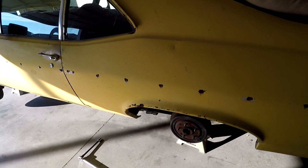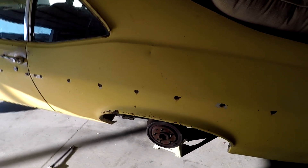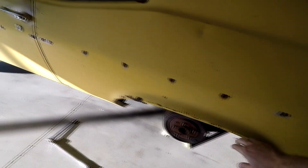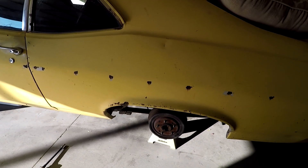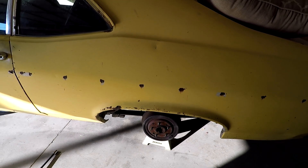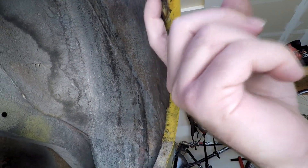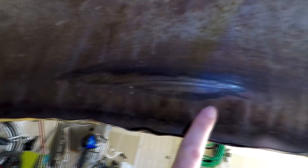However, just on the driver's side, if I make a kind of hard left turn or had some speed going around a left turn at an intersection or down a neighborhood street, I'd get a little bit of rubbing. It would happen more if I had a passenger in the car too. The lip of the wheel well has been trimmed a little bit at some point, but I was pretty sure it wasn't rubbing there. Looking inside you can see it's actually been rubbing up on the quarter panel.